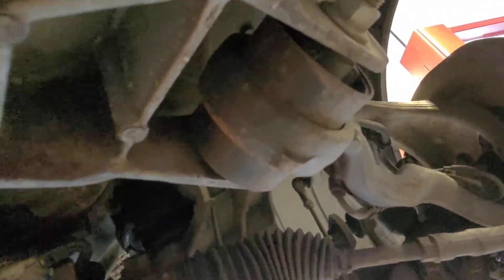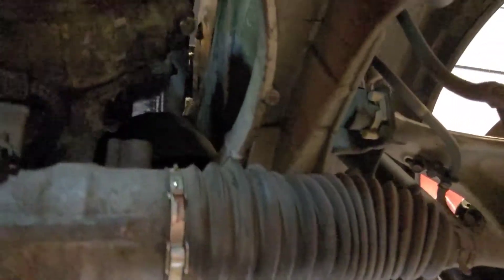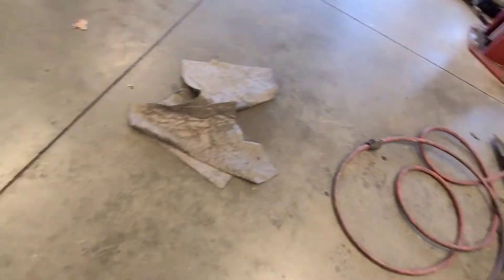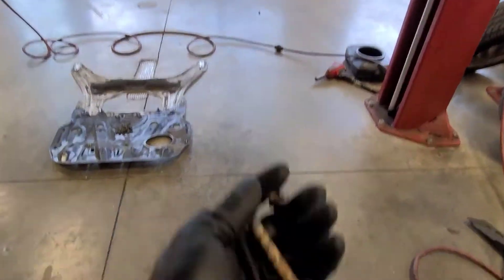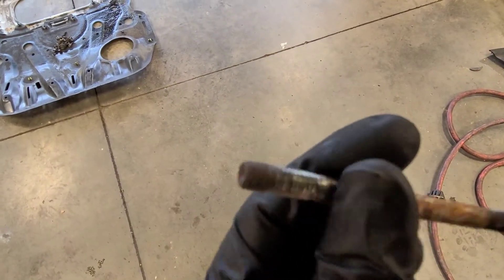Taking that low pressure line off should give me good clearance. I'll set up my flashlight — yeah, that gives me good clearance here. I can stick my hand in. Let me show you. I put my long extended three-eighths ratchet in there to remove that top bolt. By the way, this is the stud that holds the compressor — this side is bolted to the engine.